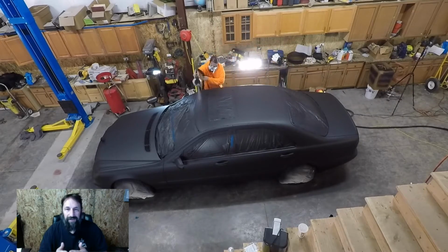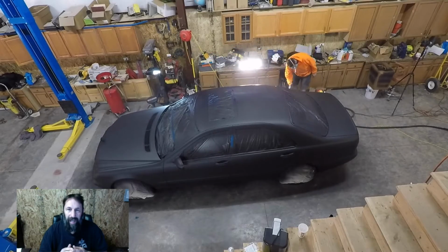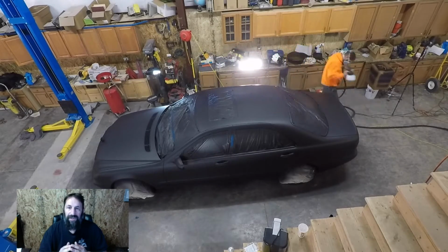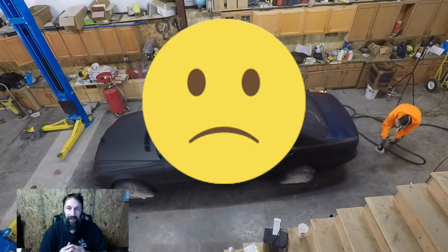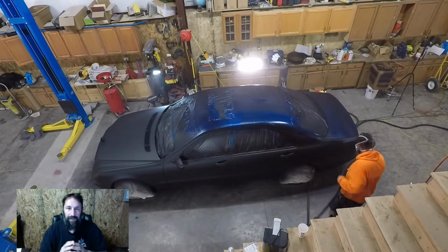After 8 coats, I mixed the 50 grams of Martian blue pearls for each gallon of top coat that I had. I used a matte top coat and I started spraying. The small spot with the water seemed to get worse. Then another area on the rear bumper by some trim seemed to be having the same issue. It was pretty sad stuff, but I just had to keep going. So I finished spraying with the intent of fixing it later, as I knew I was going to mess it up if I touched it.